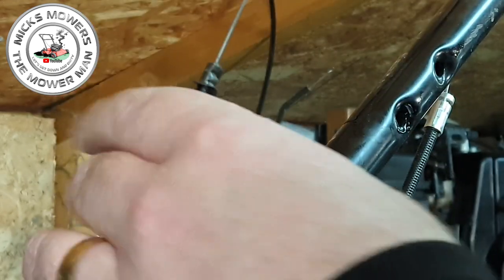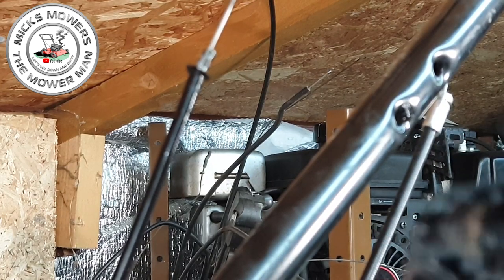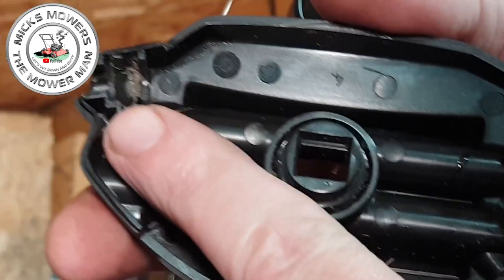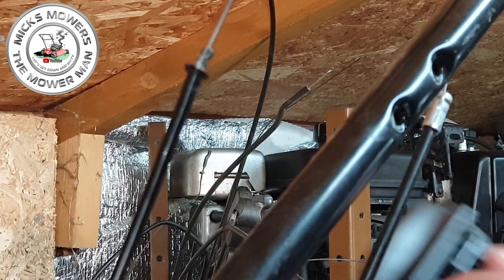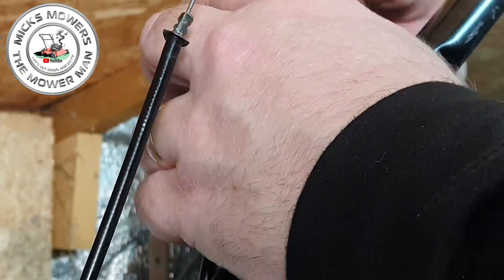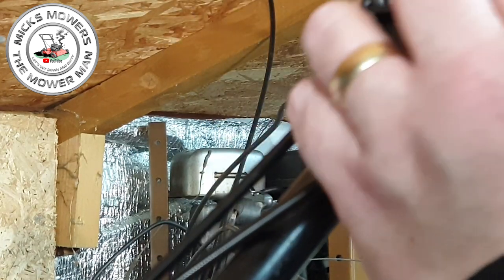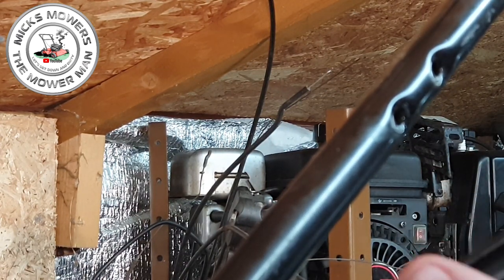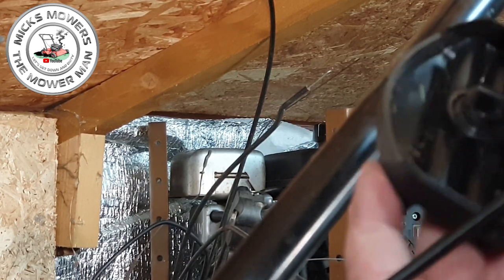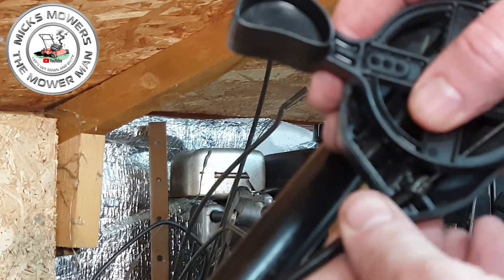So now we can bring in our control — it was the second one down. That's my cable end. Make sure that these snap — that's what happens, these snap just there, but they give you two goes at it, there's one on the other side as well. So now that cable's onto there. I'm going to put this one in the second hole down. Oh, I've fit it back to front — not a little matter. It's got to fit inside this groove — that's where it's got to go, just there. Got to sit into there, tip that round.